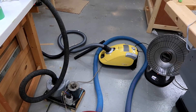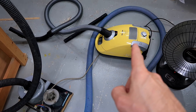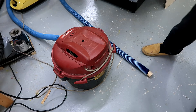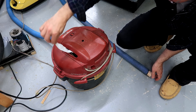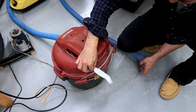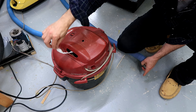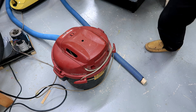Now, the other comment that kept coming up is that the vacuum cleaner needs airflow to cool the motor. And for a house vacuum cleaner, that's true. But for most shop vacs, it's not. On the shop vac, the main airflow comes out the back, but on one side of the top there's air sucked in and on the other side it's blown out. If I stop all airflow going into the shop vac, that airflow still keeps going. So the motor has its own cooling fan, which is completely independent of any air that's sucked through the vacuum cleaner.